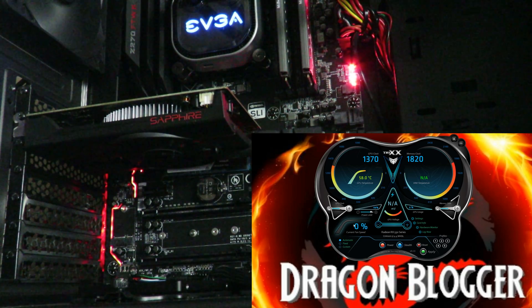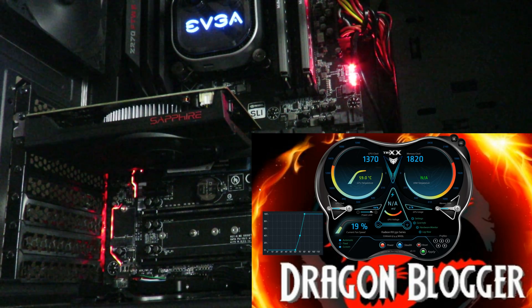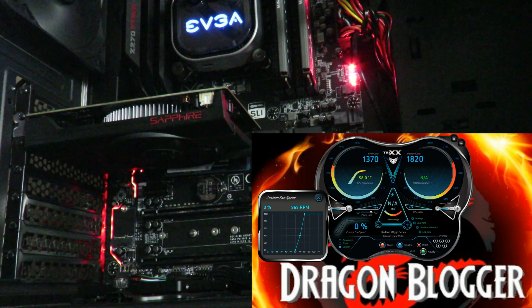So now you have options here. If you want to set your custom fan speeds, you click right over here on custom and then here you can set your fan curve. So for example, if the card hits 40 degrees right over here, you would put this right over here — it was at 60 just to remember. Now you can see just by moving it, it went up to 40 percent. I moved it up to 40 percent at 40 degrees. So I'm going to drop it back down to zero, and you can see how that went back down to zero. So that's one way of doing it.